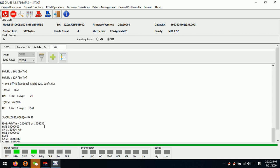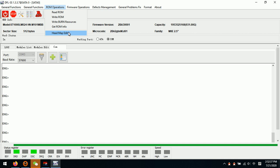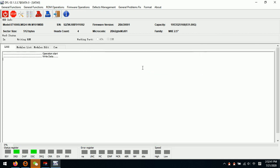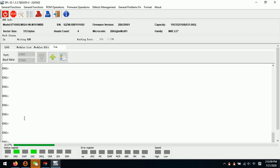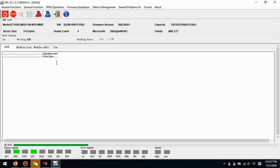We go to the COM port and try to click. Now we can enter the ENG prompt. Let's try to write the new ROM again. After users write or read the ROM, it is better to power off and power on for Samsung drives and then continue. Before reading and writing, it is better to test in the COM port if the HDD can enter the ENG prompt. Only after users are able to enter the ENG prompt can they write the ROM successfully.